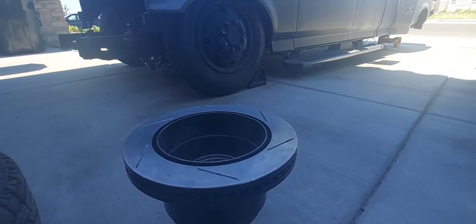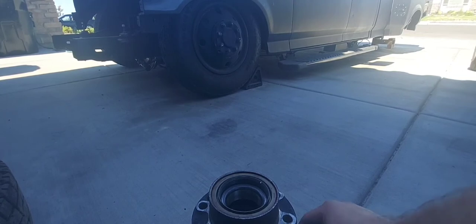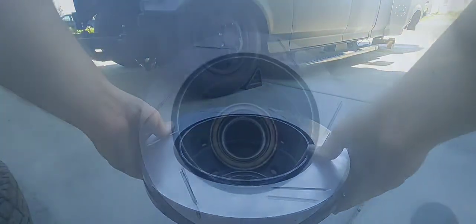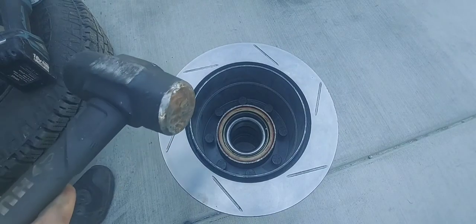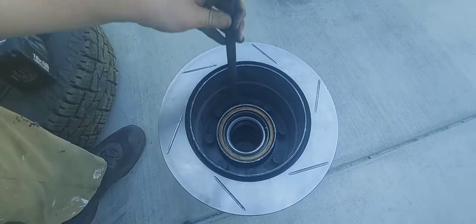We're back. Got the rotor all milled out so it's nice and flush down on the machined surfaces — factory machined surfaces. All I did was knock down the little bevel around the lugs without touching the flat surfaces, to ensure a nice flat level surface to set the rotor on. The rotor is machined out to fit that diameter. Now we're going to drop our wheel studs in, take a sledge and a punch, and drive all these guys in.